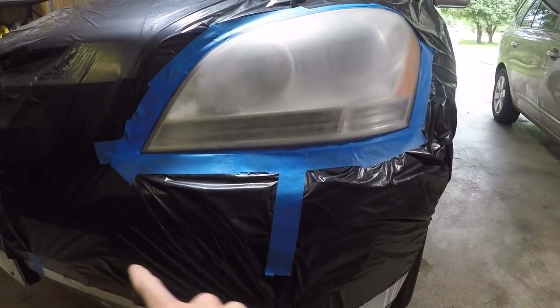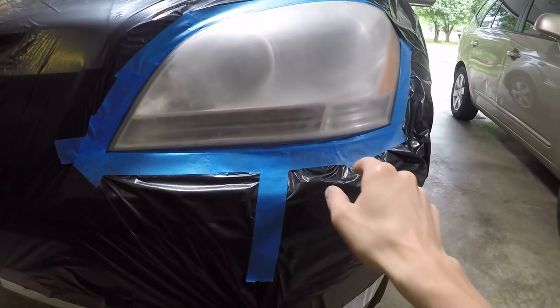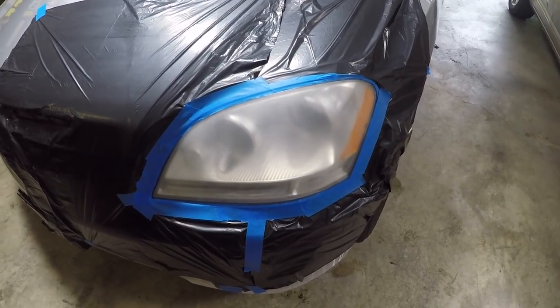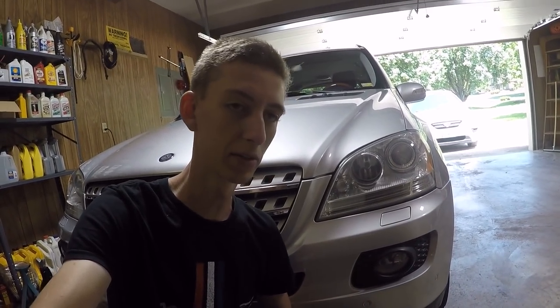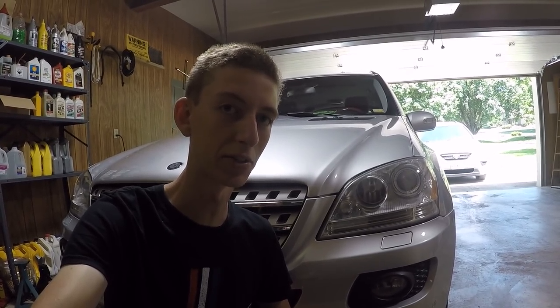As you may be able to see, I've taken two trash bags, cut them up, and taped them over all of this — taped over the masking tape we already had on the headlight — so now we should be protected. You don't want to get this clear coat on any of your other paint or anything in the area. If you're considering doing this with the headlights on the car, I do not recommend it. I used these trash bags and they protected what they covered, but I got overspray on my whole car, even the back window, and spent last night using a clay bar to remove it. I definitely recommend removing the headlights — unless you're going to mask off your whole entire car, it'll just make your life a lot easier in the end.